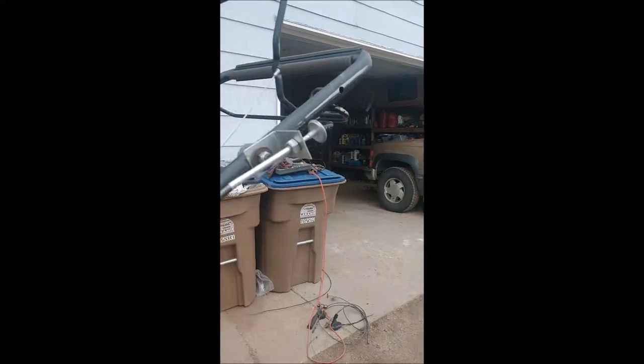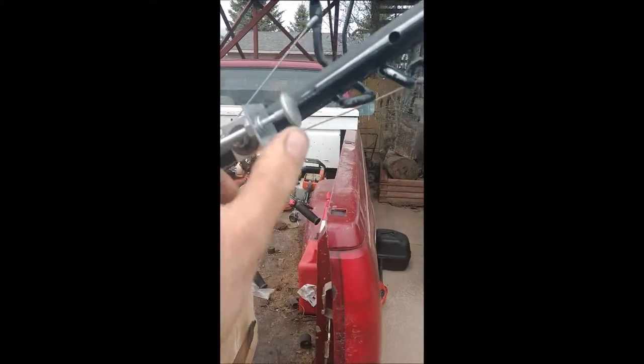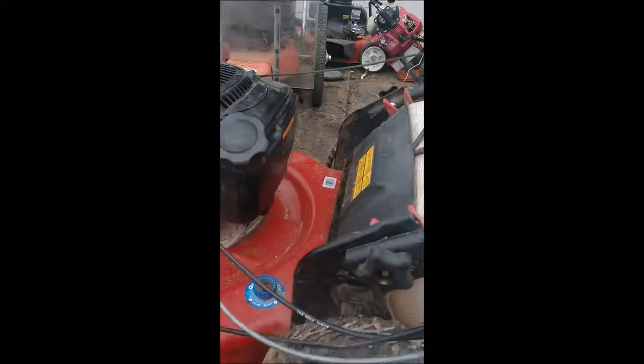Okay, so as you can see, I went to a full manual. This is just a real cheap choke assembly, I think like $8 or something. I had a little L bracket, so I just bolted that. This hole is already here, believe it or not. So I just bolted that to the handlebar frame. The choke cable is just a tad long, but it's no longer than the other cables that are already on there. So I'll probably bundle them up and tidy it up a little bit.